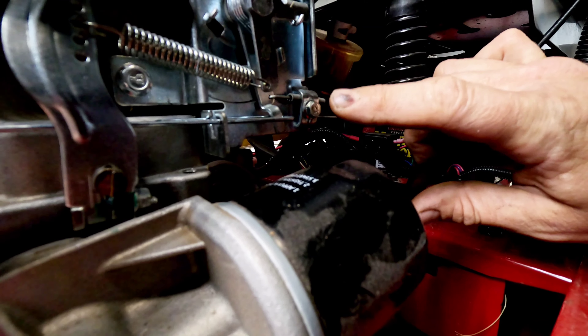You can also pull the plug out and stick something soft down inside to verify the piston is actually moving up and down. Turn it by hand once you've got the cover off - that confirms everything is moving. Sometimes connecting rods break and the piston won't move at all, giving you no compression. You can also turn it by hand to check that the valves are going in and out, coming all the way out. That should give you everything you need to know for a Toro Time Cutter won't-start diagnosis. Thanks for watching - like and subscribe.